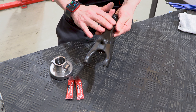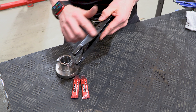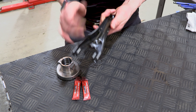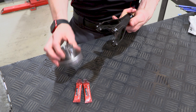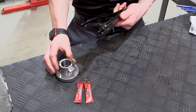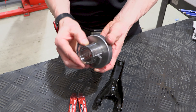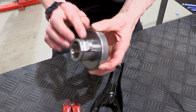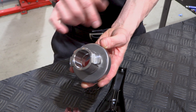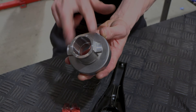The next component you're going to want to look at is the clutch fork, to make sure there's no significant wear or hairline cracks anywhere that could potentially be causing problems. Anywhere it makes contact with the release bearing, make sure there's no significant wear and no excessive slop on the actual bearing or bearing carrier itself. If you're reusing the bearing carrier, like a Nissan one for example, check for significant wear on the edges where it rotates and in the pockets where the fork actually operates.